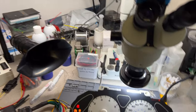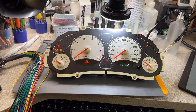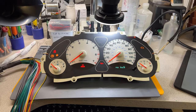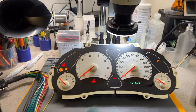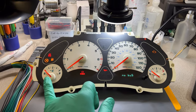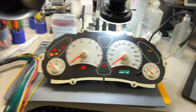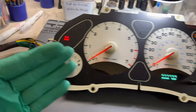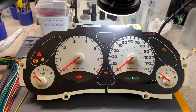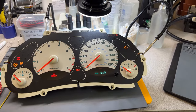All the needles were pushed too much and were in the incorrect place. With these instrument clusters you do need to do a calibration, or you can mark the needles, adjust them, and put it back. I'm already partway through fixing this — I still need to work on the fuel and temperature. Using the Autel Elite scanner, you can see the needles are reading seven thousand, three thousand, one thousand, and zero. Same thing with the speed. This is the sweep test that Chrysler and Jeep do for their clusters.